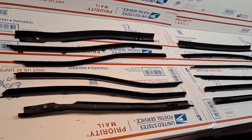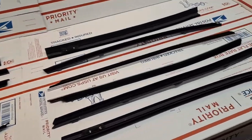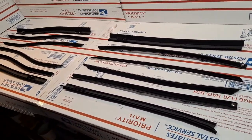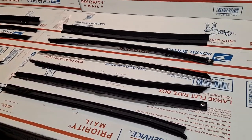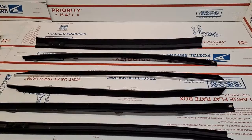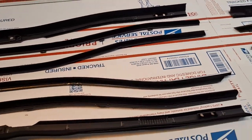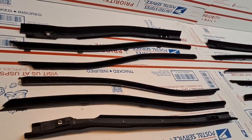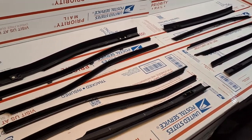Today is Monday, November 22nd. This is the 1975-1976 and 1971-1974 Cadillac Eldorado Convertible Rear Window Sweep Seals, comprising the external rubber weather stripping and the internal felts, each of which press against the large monolithic windows in the front, providing a seal so that water doesn't drip into the interior of the door panel.